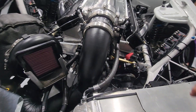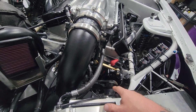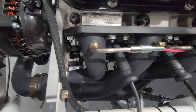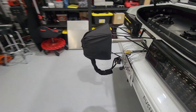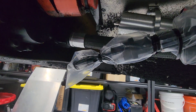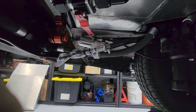It's a little different with my car — some other people just have a pulley up here that drives the fuel pump cable, but mine uses an external oil pump from Moroso with a cable driven off the back of it. The cable's buried down in there and it's a pain to get to, so what I came up with was: if you come to the back of the car, it's pretty simple. You just disconnect it right from the pump, then take the cable out of the sleeve — slide it back so it disengages from the back of the oil pump so it doesn't spin when we're driving down the road on pump gas.